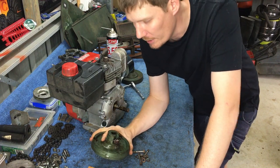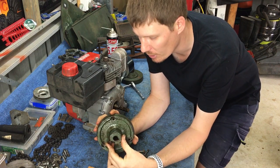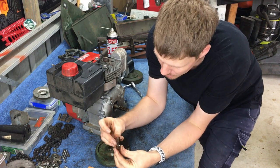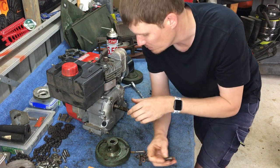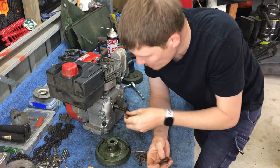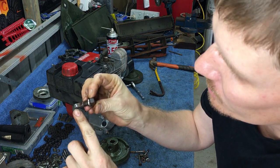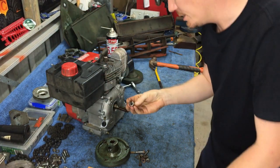We've had success! I actually believe the cotter pin here was jammed on the engine shaft. I can see on the cotter pin that there's almost like a flat part at the bottom of it — that should not be there. I reckon that's what was jammed on the engine shaft. The engine shaft itself doesn't appear to have any damage. See this flat part here on the cotter pin? That definitely should not be there — that's obviously going in the bin.